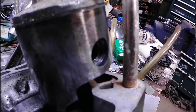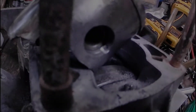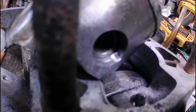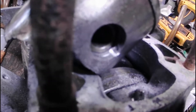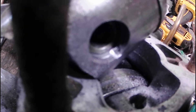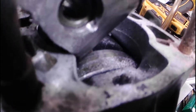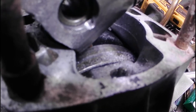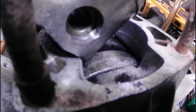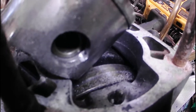Although the other piston looks good, I tend to replace them in pairs. There's the groove I was talking about. I'm going to rotate it and grab the end and pop it out. You can see lots of little aluminum flakes and stuff, but as I already mentioned, I have to tear the whole bottom end apart and do a complete clean out on this motor anyway, just because of the debris from the broken piston. I'll bring you back once I get the pistons off.